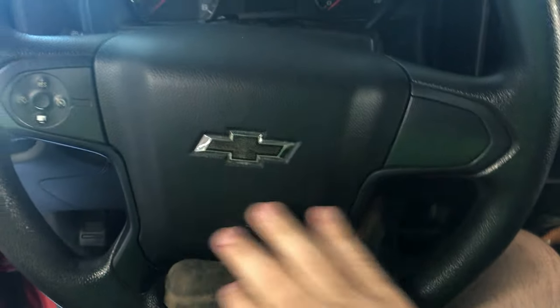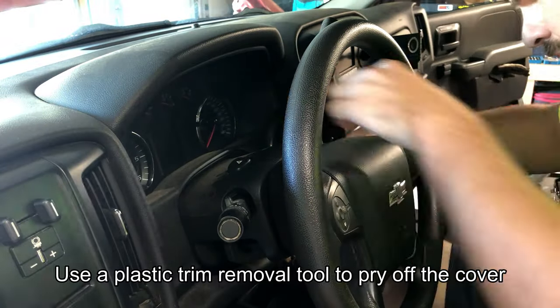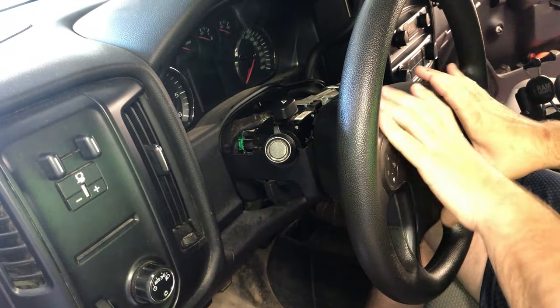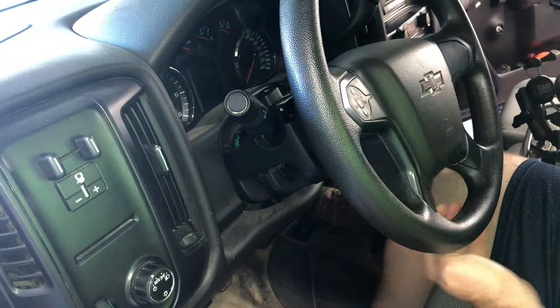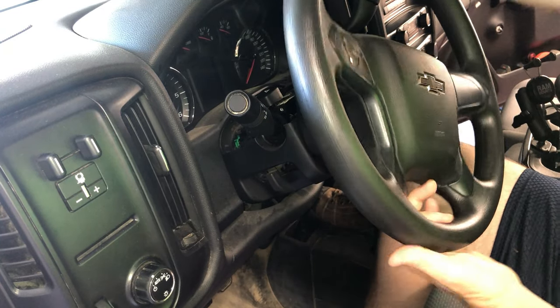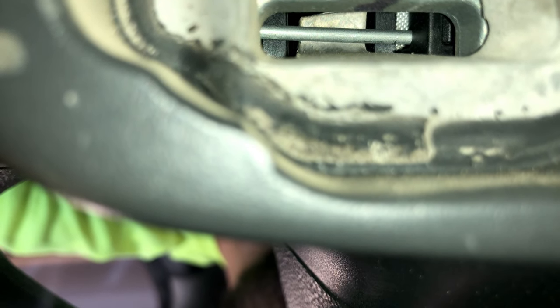One of the first things we need to do is pop out the airbag on the steering wheel. We need to remove this plastic housing here to reveal access to the backside of the steering wheel. The way this airbag is held in, there are two posts that go in on either the left and right side of the steering wheel. You have to turn the wheel 90 degrees one way and 90 degrees the other way to get to where those posts are so you can reach in from the back and lift them up. Insert your key and give it a turn, then turn the wheel all the way one way 90 degrees. This part is actually pretty difficult to do because of the visibility — I had to use my forward-facing camera and the screen on my iPhone to find exactly where the bars are that you have to lift.